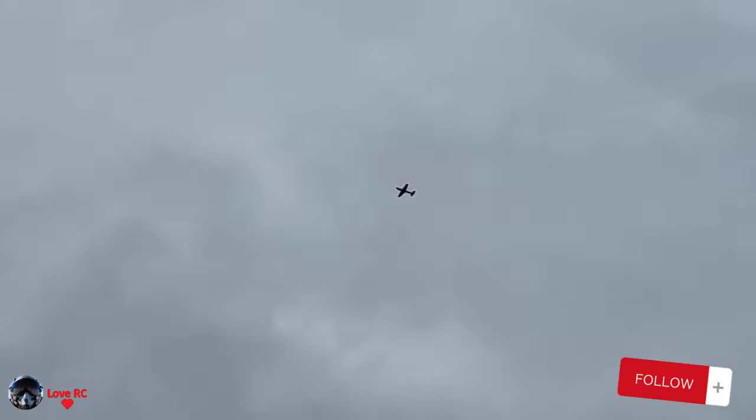We had set it back to neutral and did a couple twists on the elevator linkage and it was still going up. Later, after I got home, I found out that the left side of the elevator was sticking. So when the surface moved, it was moving the right one a little bit more than the left one. It kind of looked warped, but it was just because the left side was sticking. So I worked the elevator and now everything is straight.